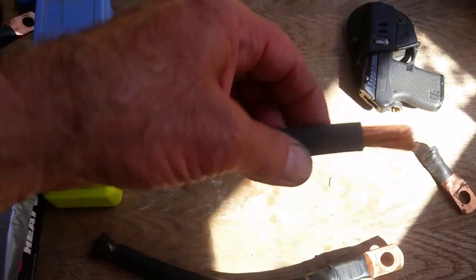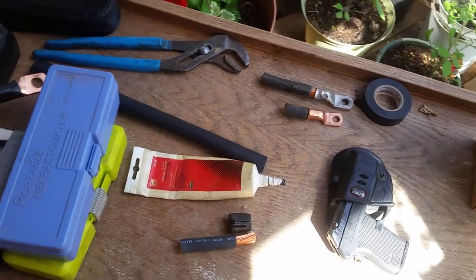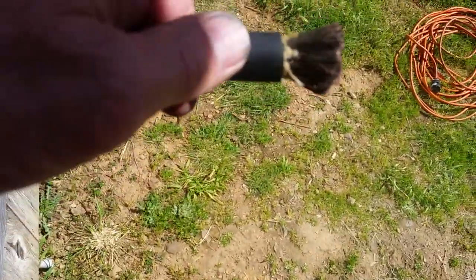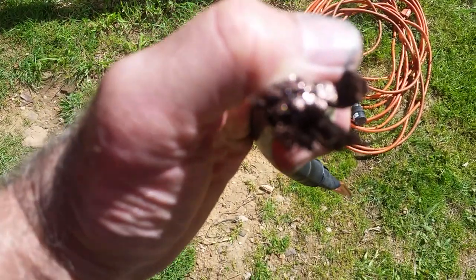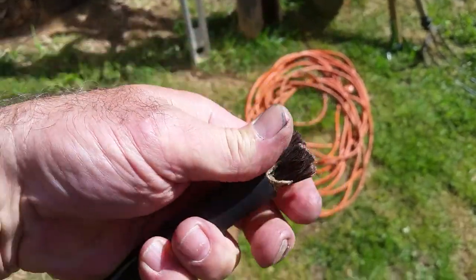So this is the new cable — that's what's left from the new stuff I installed, and it should be bright like that. I also got pre-tinned lugs. But this is the old interconnect cable — I'll bring it out into the sunlight so you can see the oxidation. That is not bright shiny copper at all. You can see on the end where I cut it, it is bright. But current travels on the outside of a wire — it's a true story.